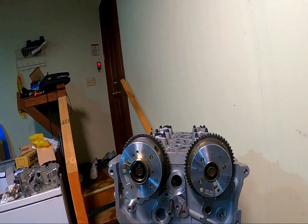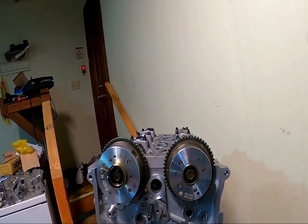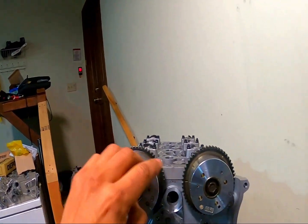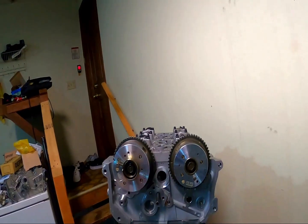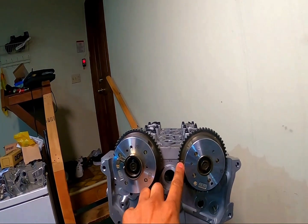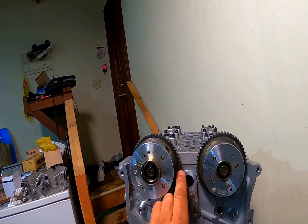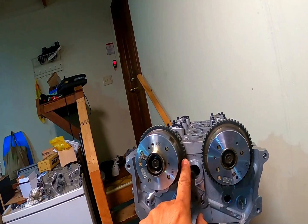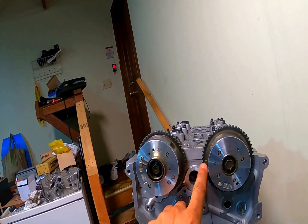You've got five timing marks. I'll try to zoom in when I'm editing this video. You've got a timing mark right here — it's a little dot — you've got another timing mark right there, that's another little dot. You've got a timing mark here on the cam, and it's interesting because the timing mark across from it isn't sitting in the same spot — it's sitting oddly right here, not actually on the actual gear. But these two should be across from each other.